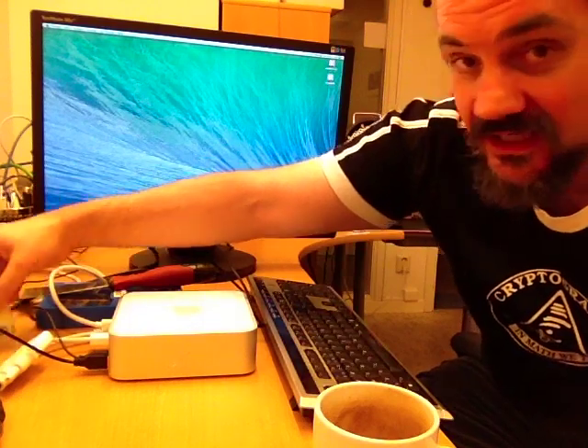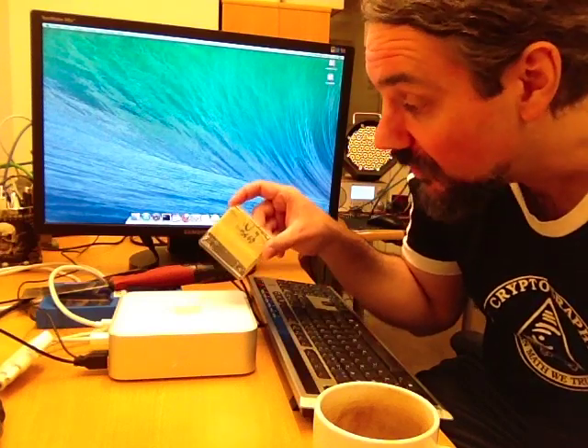Hi, this is me again. Today I took this old Mac Mini — it's the Intel version, the one before the aluminium, but not the first Intel version. It's the second Intel version with a Core 2 Duo CPU, but it only has 2 gig RAM. I tried to put in 4 gig, which I have here from a newer Mac, but Snow Leopard which was on here crashed.